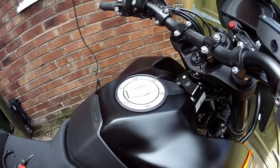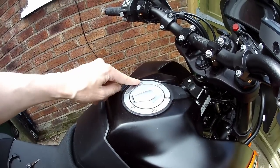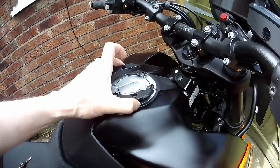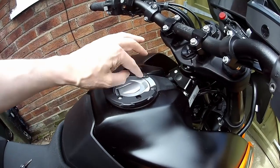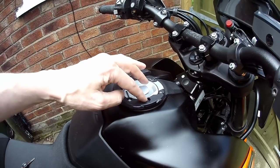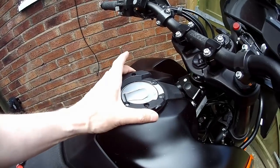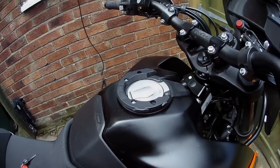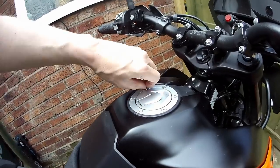It's quite straightforward otherwise. One thing to take note of is that these screws are different sizes — there is a longer one here, a longer one here, a shorter one there and a shorter one there. Now because the tank ring has a thickness to it, that long one has to be a bit longer to account for that, the short ones have to be a bit longer too, and the long one on the other side has to be even longer. So the screws turn out to be four different sizes instead of two — a bit complicated, but it would be okay if the out-of-box screws provided had worked, which mine didn't.